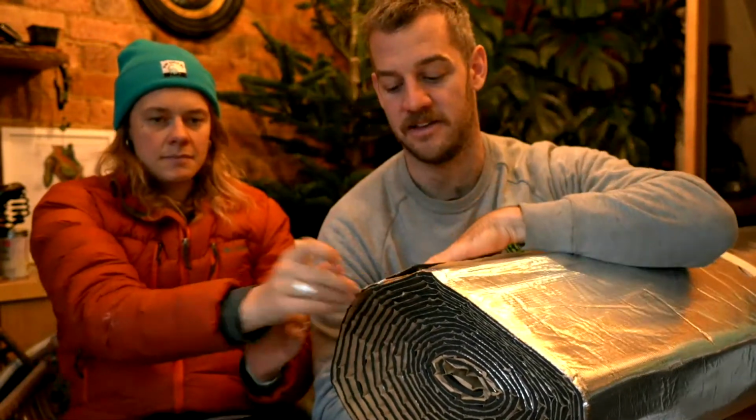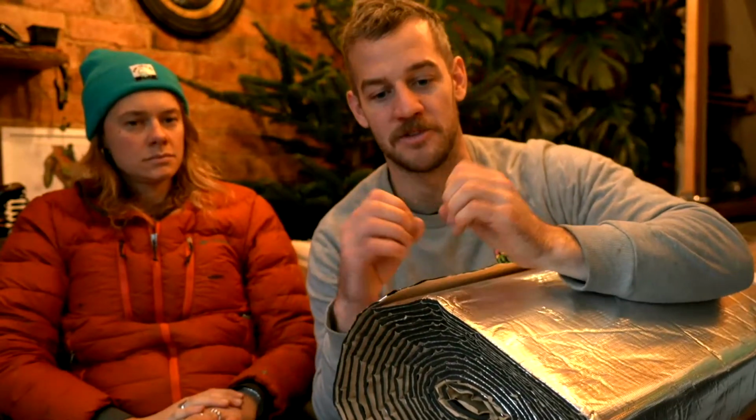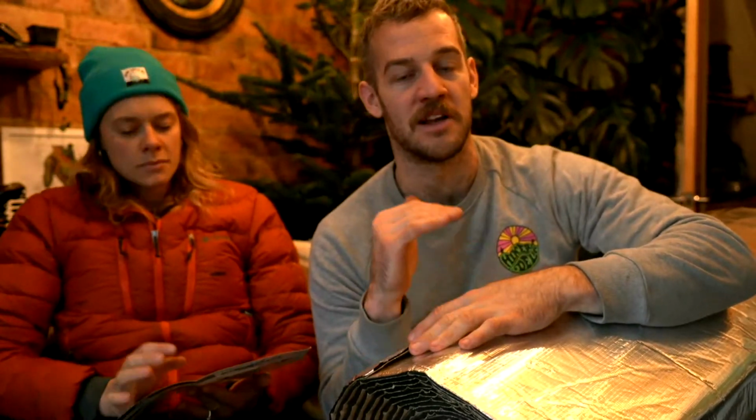Bear in mind, insulation is all about trapment of air bubbles, and air is super non-conductive to thermal properties. So it's the ability for it to trap air. I use this as the so-called vapor barrier. So this will be the last layer, which covers all your screw heads, any sort of wood exposure, but it also covers any air gaps in between PIR board, like your big chunky insulation board, and any more bodywork. This completely seals. This is the final layer I put on all our vans.